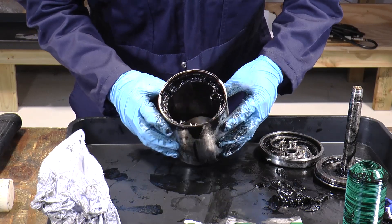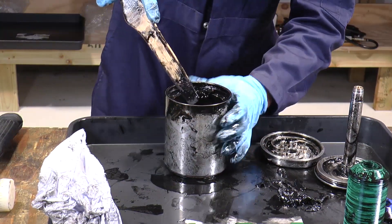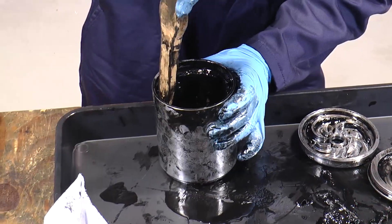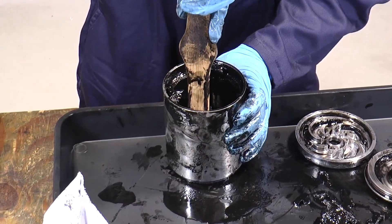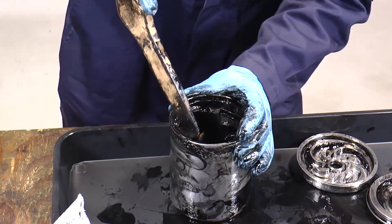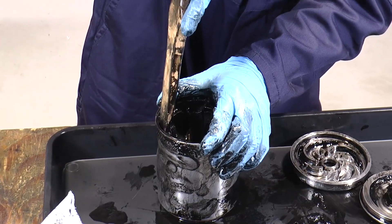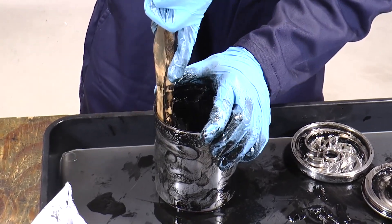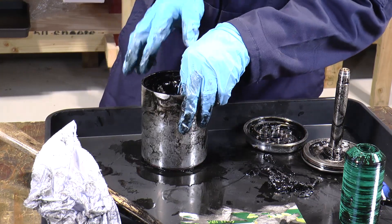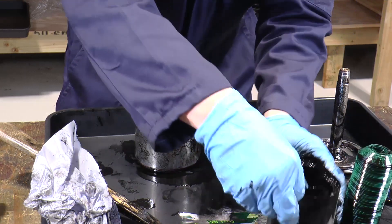Finally we need to remove the main sludge cake from the bowl wall. Use our spatula — either wooden or nylon — to get behind the paper insert, and just push behind the paper liner all the way down to the bottom of the wall. Do the same on the opposite side, making sure you get behind the paper liner and just ease it away from the base. You should then be able to use your hands to remove the paper and the dirt cake in one piece.